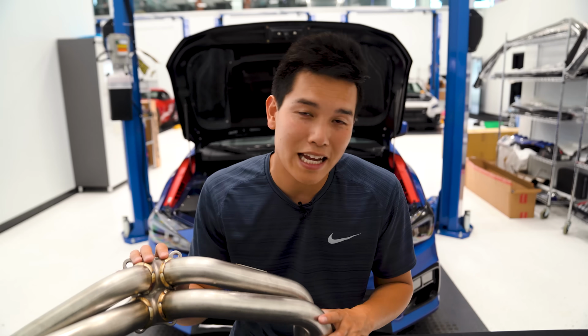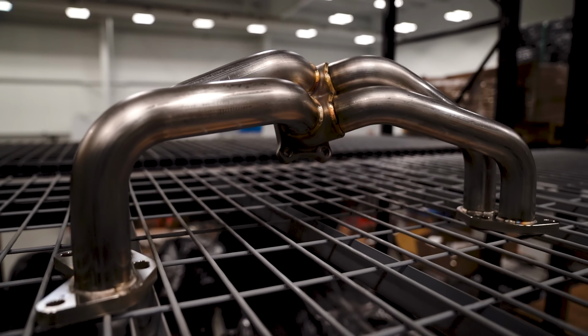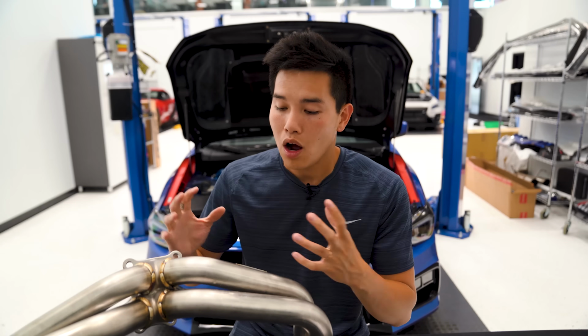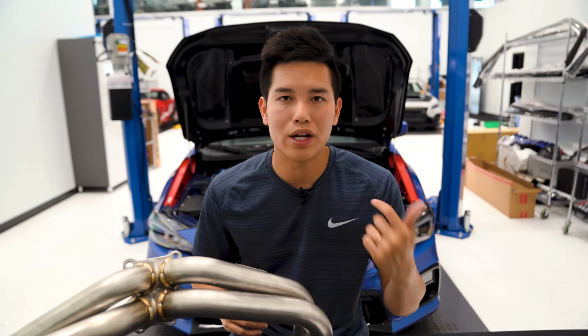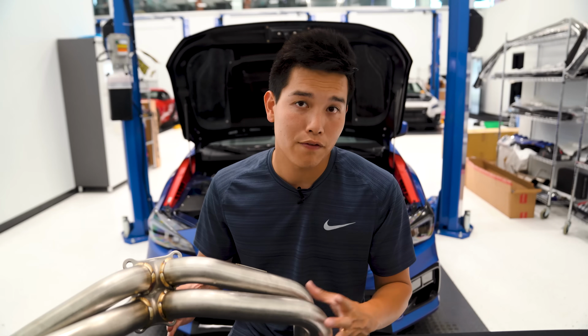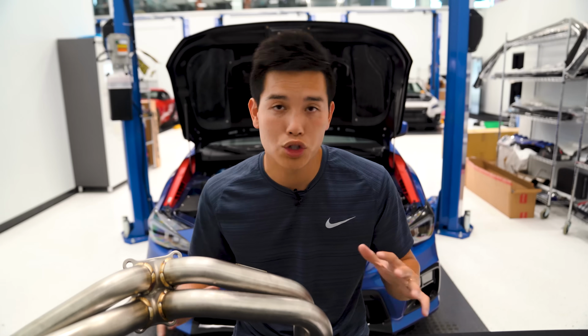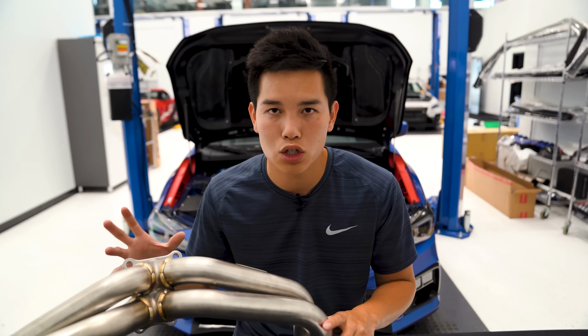All those things result in a pretty good looking header for the WRX that should also give us a substantial increase in performance. How much performance, you should ask? Well, on a car with some simple bolt-ons like electronic boost controller, intake, J-pipe, catback, front mount intercooler that made 254 horsepower and 264 torque. Once the header was installed with no tune, it made 259 horsepower and 279 torque.